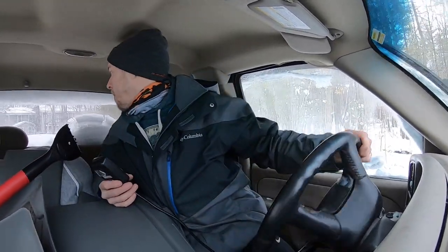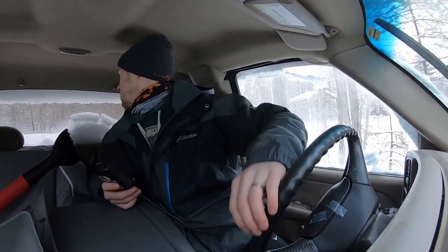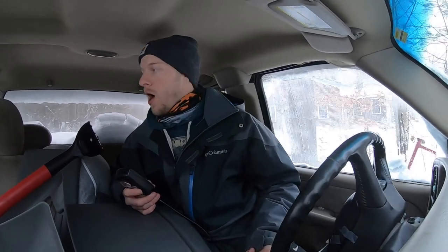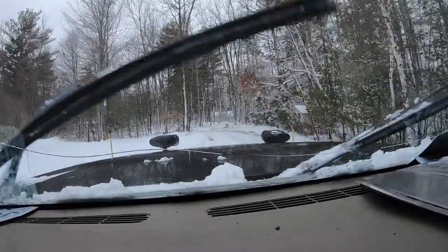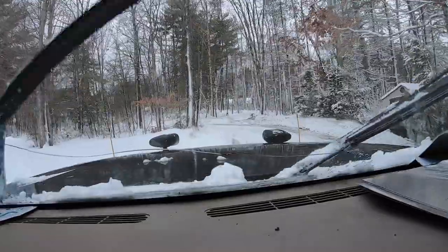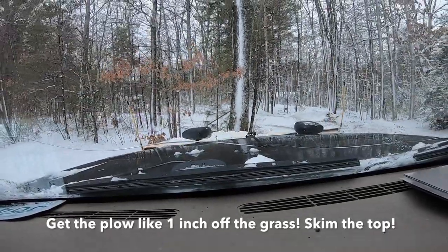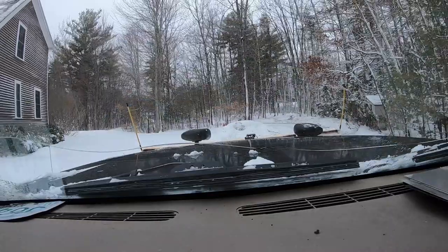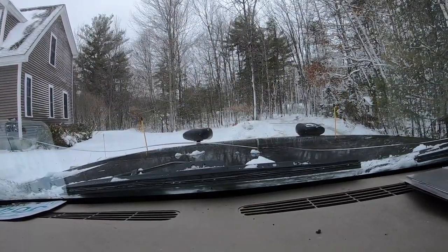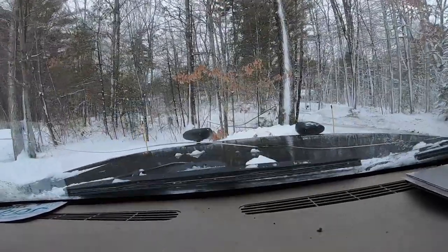Make sure you straighten the plow out when backing up. Also make sure you have good windshield wipers and your defrost works — you definitely want to be able to see where you're going. Now, since we're done with the long part of the driveway, we'll do the big side with the cars. Before we do the cars, I clear this grass area. Put the plow down and then give it a couple key clicks up so it's not dragging completely on the ground — that's how you plow over grass. You don't want the full weight of the plow on the ground. Kick the plate up to literally about half an inch off the ground and just skim over.